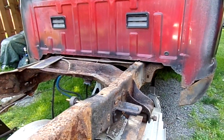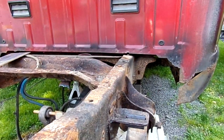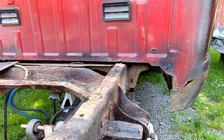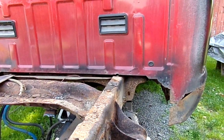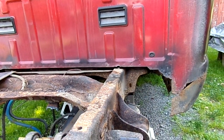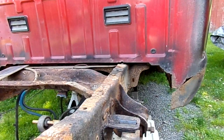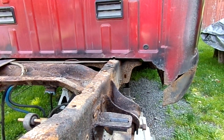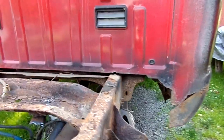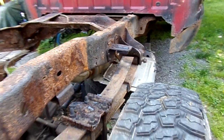So when you're dealing with stuff like that, that's okay. This truck is aged and it's got other issues. Believe me, it's got other issues. He could probably have other reinforcements put in there. I'm going to ask him if he wants that when they come here to put the frame on, because it wouldn't be too much more to enhance that part of the frame up there under the cab. The rest of it's not in too bad a shape, but this back here is totally gone. I mean, it's like Swiss cheese.